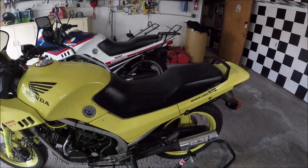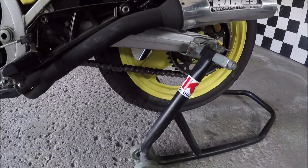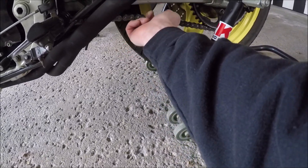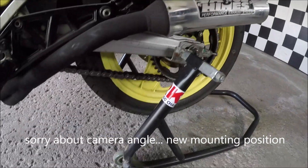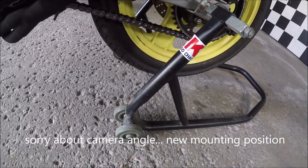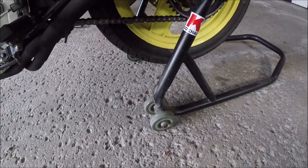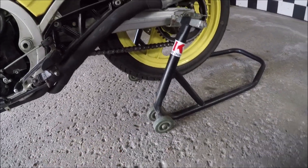I'm not going crazy — there's something wrong with the rear end. I didn't know if it was just because I hadn't ridden in a while. For one, the chain — I don't think I had it this loose, but this is too loose. And if you look, this pivot is broken. When the master comes around, it's not moving right. It felt weird when I hit a big bump. I don't think this thing's safe — the master's seizing up. I've got to replace this, it's probably not safe to ride right now.